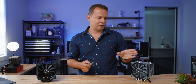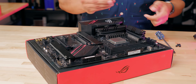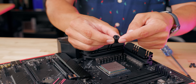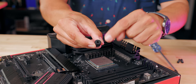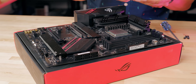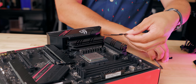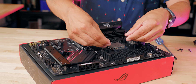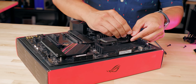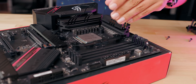We're going to pop this onto an AMD system. Right away, this is one of the easiest installations you'll probably ever come across. Scythe's little details shine here — the spacers used across all platforms also have a vibration dampener, so there are no vibrations between the plastic spacers and the metal bracket. Put those on the AMD backplate one by one, then take your AMD bracket with the provided screws, thread them through manually, and screw them down with Scythe's included screwdriver. That's how you put on the retention arms.